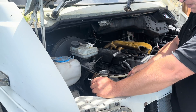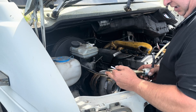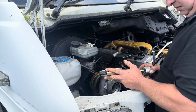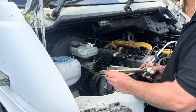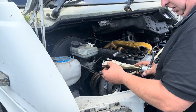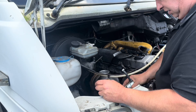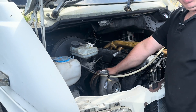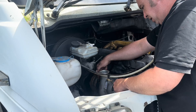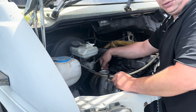Now this wastegate bolts on three bolts on the bottom and has this big lump poking off of it. Sadly, with that big lump on there, this is about two mil off the steering shaft, which is not really what a man needs. So it's got some spacers and a load of stuff, so it doesn't need this bit - I could just get rid of that. So what I'm going to do now is take this back off, get this on the bench, drill some holes, pilot some, put some threads in it, get the bolts all to work so I can bolt this oil flange on the top of there.